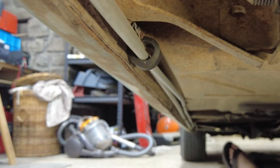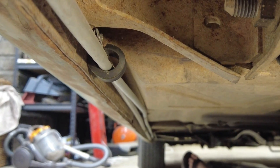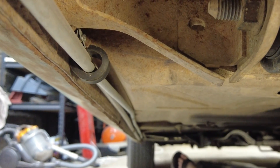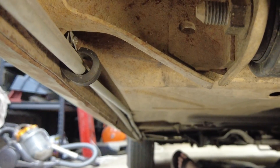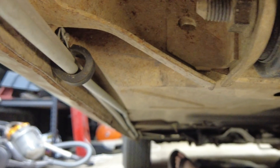I had to fabricate two new fuel lines — a return line and a new supply line. As I mentioned, the original supply line was 5/16", and initially I thought I could get away with using it as a return, but with such a long line with so many bends in it, it was definitely advantageous to make the return line 3/8" as well as the supply line. Decades ago this car used to have an LPG system installed, and the fuel line came through that rubber grommet there, so that became the perfect place to shoot the return line through.